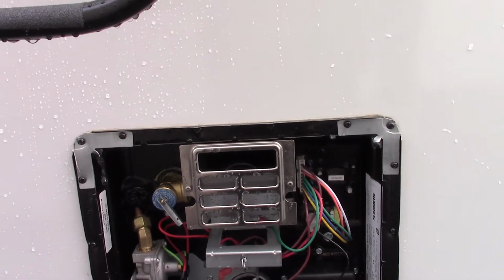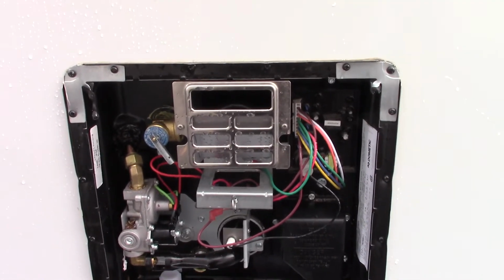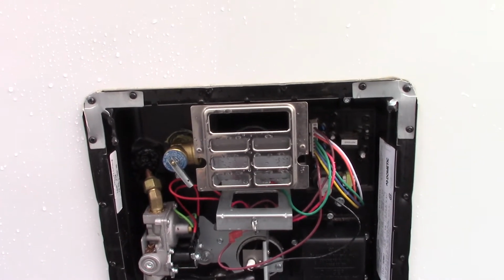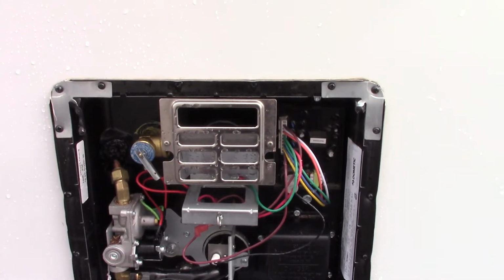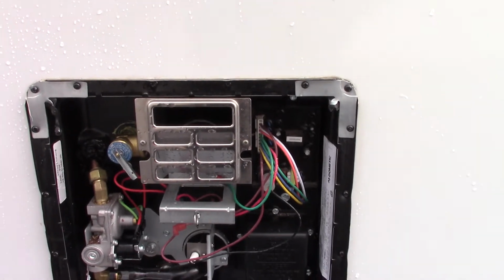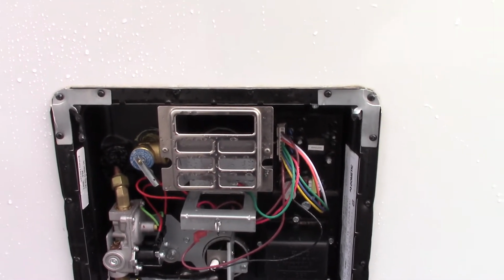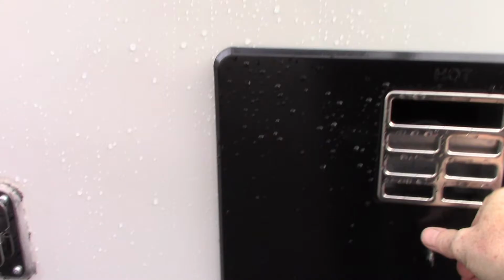To fill it up, it's in bypass mode right now because it's winterized, but you'll flush the system out. Then you'll change the bypass valves, which are on the back of the water heater. I can't really go into it at this point, and you may know all this, but if you don't, you have to educate yourself a bit on it. You put it into camping mode and turn on your hot water, say over the sink. You can use any hot water valve you want. The air will come squirting out, then you get a combination of air and water, and then solid water eventually. That's when you know the tank is filled, when you get solid water. So never run it without water in it.